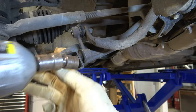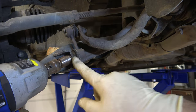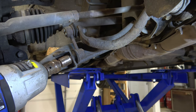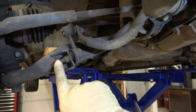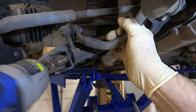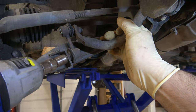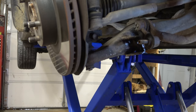The last step is to remove the sway bar end link bolt down here. If you don't have an impact, use a 14mm wrench — or better yet a ratcheting wrench and an Allen head, I think it's a 6mm that fits in there. Hold that and rotate. Sometimes with an impact you can get it loose. And that's it — she's free. Once she's free, we can proceed with removing the strut.